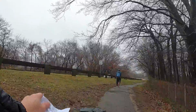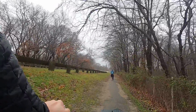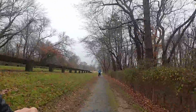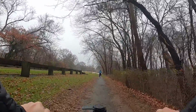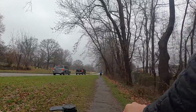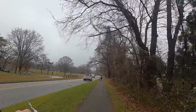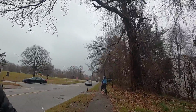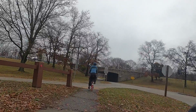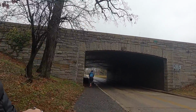I guess some negatives about the tires, I would say, might be that they are a lot harder to install. I have not successfully installed them by myself. I've always needed someone to help get the last bit of tire onto the rim. So if you watch my other video, you can see how it's done. I've been doing it the same way as in the video, and I've done it about 8 times now. And if you do decide to purchase the Tannus tires, I would recommend getting the P-tool. The P-tool is absolutely necessary if you want to install them. And installation time, when you get proficient at installing them, I would say it still takes you about a good 20 minutes per tire. So it might take you 40 minutes to an hour when you're doing it the first time.